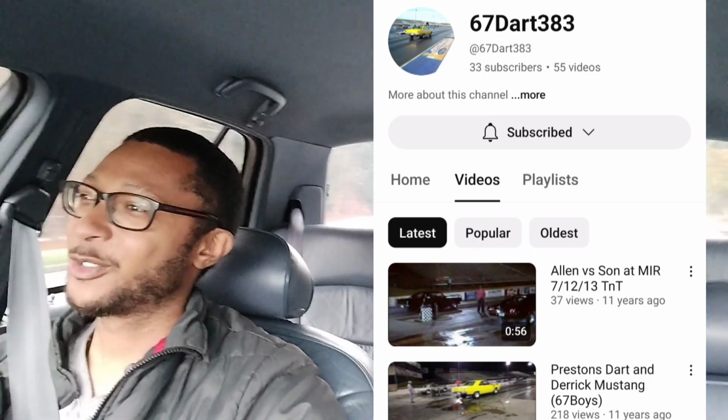But like I say, Crown Victorias, they're great cars, solid body-on-frame platforms. They're simple to work on to a degree. Some things are more difficult than others. Like I say, that's why I haven't even replaced the lower ball joints yet, because it has a coil spring that's attached to the lower control arm. So the next project is to replace the lower control arms. See, another expense.